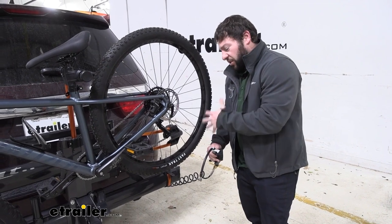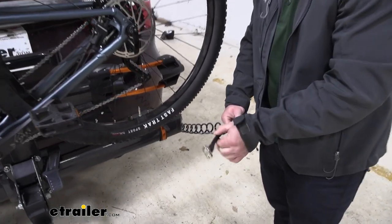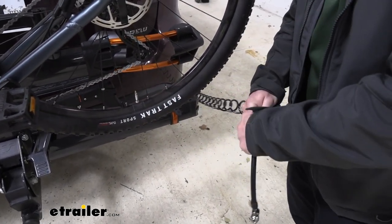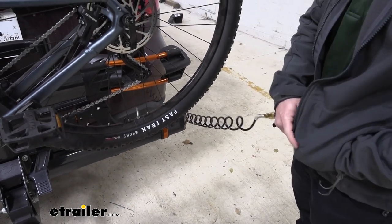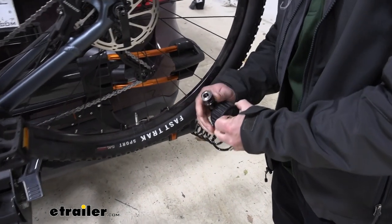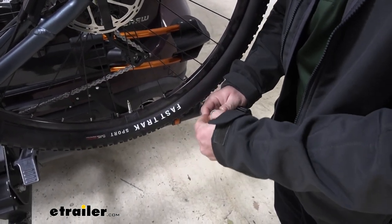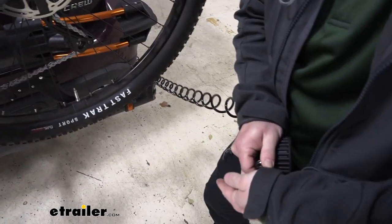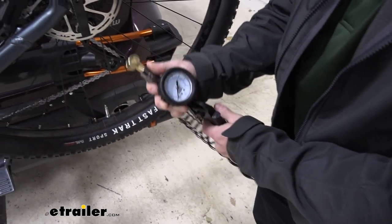At the back of the vehicle here where our bike is, it's hanging from the stand so that I can check the tires. Right now it has the standard air hose that would work with a Schrader valve. This is going to be a Presta valve, so it does have different accessories it comes with so that you can inflate other things. We need the Presta valve attachment. This is going to go in the quick connector right here. Make sure you push down on it so it goes into place. Let go — now that's locked in.